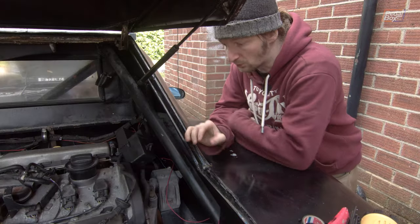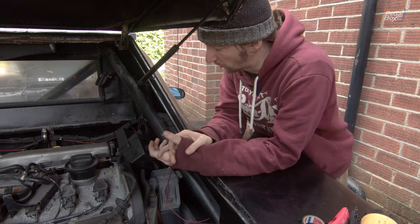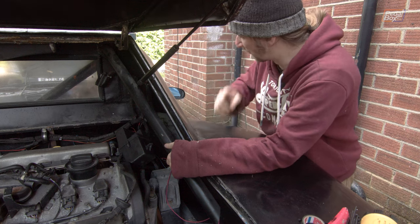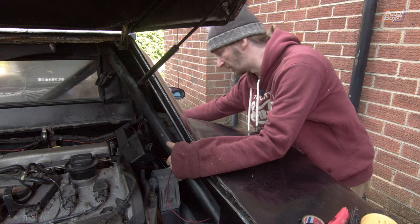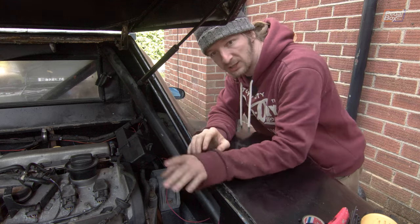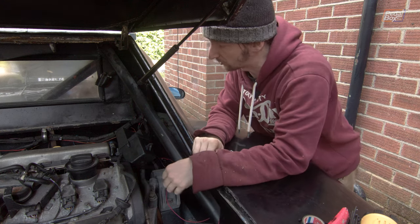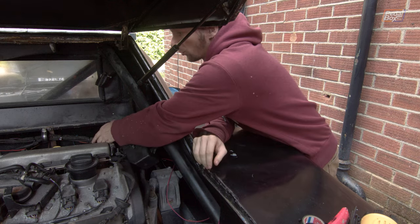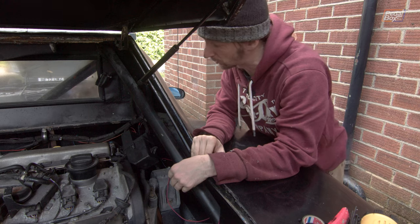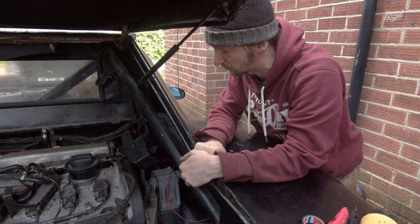Mostly buttoned up in here now — we've got all our cables running into the box and plumbed into the relay quite nicely. We've got our trigger wire running forward into our wiring harness cluster connector down in this corner, and everything else is running into our intercooler fan loom at the back, which is all one piece, locally grounded. We've got power running across to eventually connect to a fuse outlet on the battery, and a local ground to tap in up in this corner — that's going to be a future job.